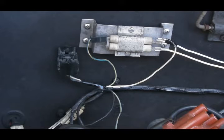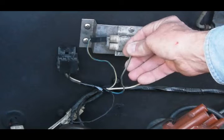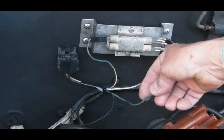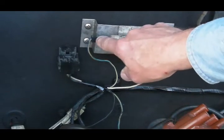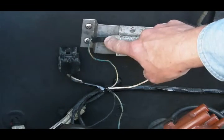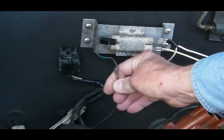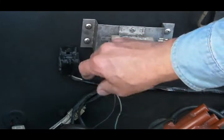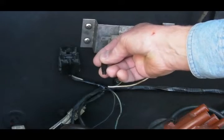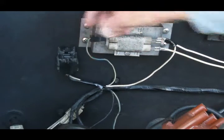The way it works is you've got two blue with yellow wires. This blue with yellow is coming up from the solenoid on the starter motor - this is what's triggering the relay. And the way they keep from mixing the two up: this blue with yellow, which goes from the relay to the resistor grid, has a female connector on it, while the other blue with yellow has a male connector. So you cannot put this connector on that terminal because it would be male to male, and you can't put the other one going down to the starter motor because the harness coming up has a female connector. So that's how they keep from mixing them up.